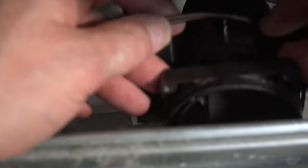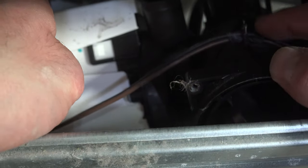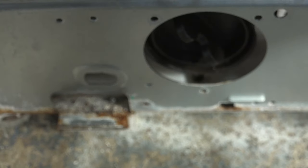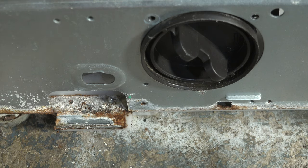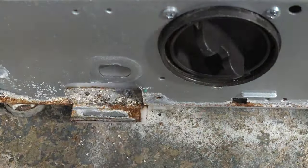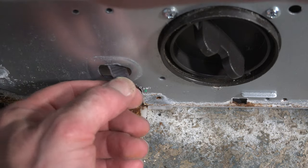Now the pump is finished and ready to go back in. Get it into position noting the track, and slide it in. Before getting it fully seated, plug the drain pump wire back in — you'll know where the wire clips in because it has electrical tape or protection at each clip point, so you'll know how much wire to pull through. Slide it forward onto the track, then put the Phillips screws in the front to mount the pump in place. Make sure the little drain tube assembly feeds back through its hole.